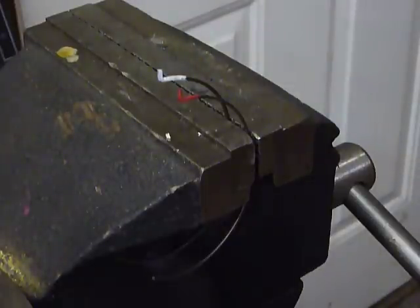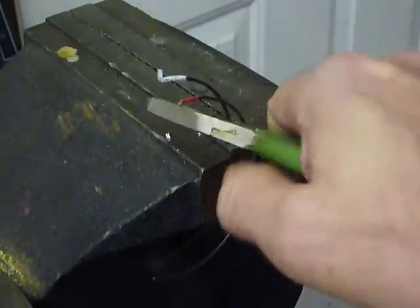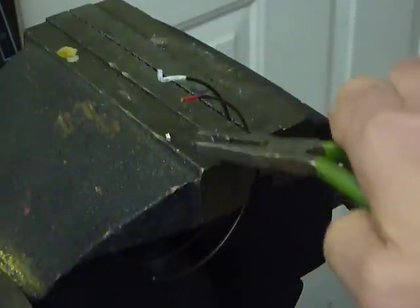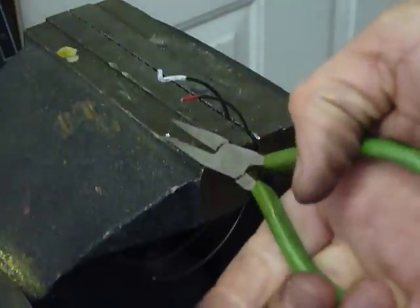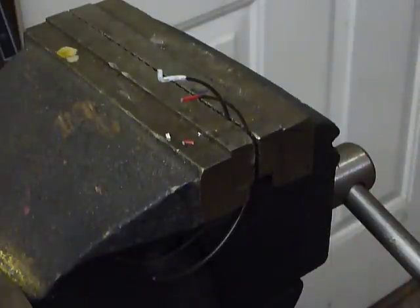What I have here chucked up in the vise is the standard Miata Spring in red, as you would buy from Mazda. What I'm going to try to demonstrate here is, in one very quick move we've broken the locating tang off of there. It didn't take much stress and strain at all. When that happens, this locating tang may appear in your drain oil, if you're paying attention.